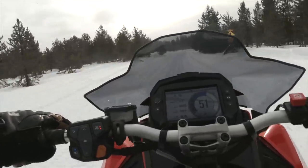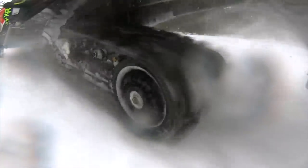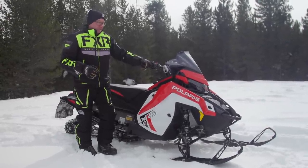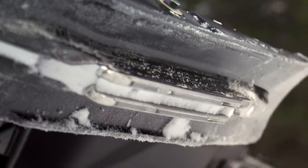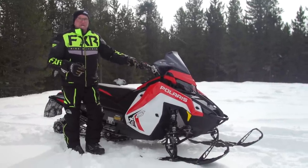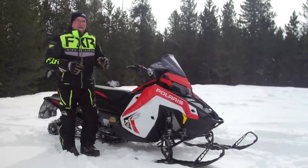What's the impression in terms of handling? Is there any material effect this engine has on the way the sled works suspension or handling wise? Pretty much across the board, everything works just like you'd expect on a Matrix Polaris with Pro CC in the back end. There is one small detail we're not crazy about: all S4-powered models come with dual runner carbides. They're there to stop darting, but they soften up the initial turn-in. About the first 10 to 15 degrees of turn-in everything is fine, but beyond 15 to 20 degrees it starts to understeer.